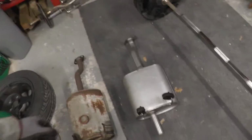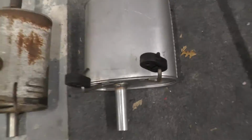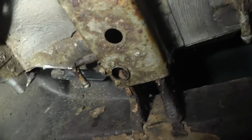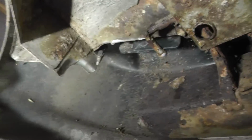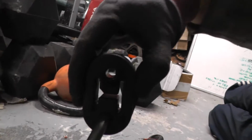So I'll go underneath the car with this. I've already put a little bit of silicone in here and here, so that should help the job. Bit of a better view of the little gasket I've got on there. So that's there. These are the studs I'm going to be placing the exhaust up and in, and need to thread it through, past the LCA, and just whack the bolts on. It's all fairly simple. So now I've got the silicone spray on these. I'm hoping it's going to be a doddle.